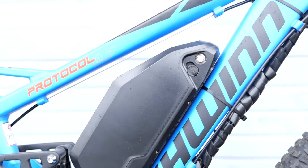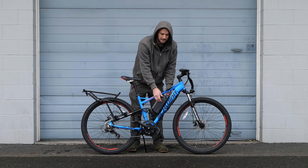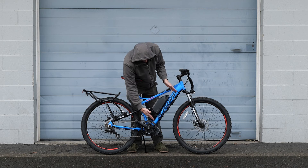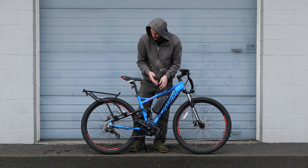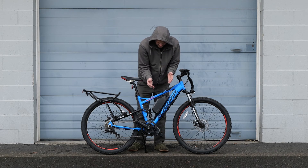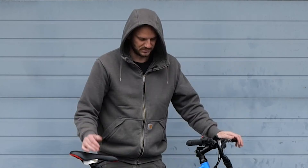This is the new battery — it was designed by Lecky, a new wedge-shaped battery with Samsung 50S cells. It's shorter than a normal shark battery, which would have hit the frame in multiple spots. With this wedge battery, we could fit it inside the frame. And the rear shock does not hit it when it compresses, which is awesome.